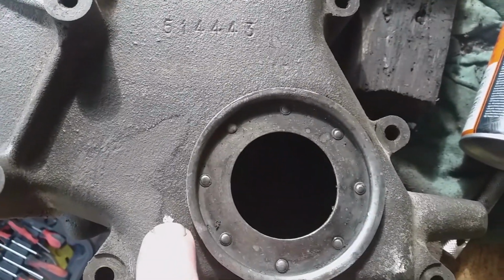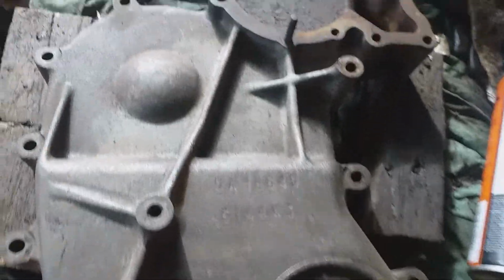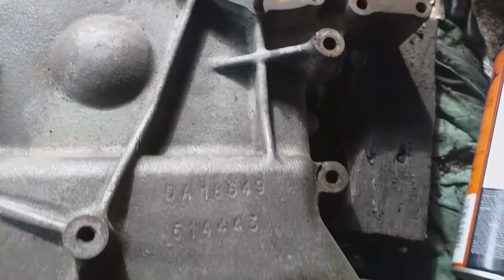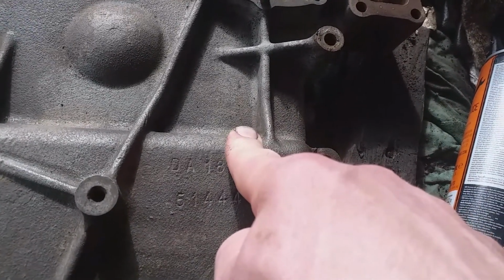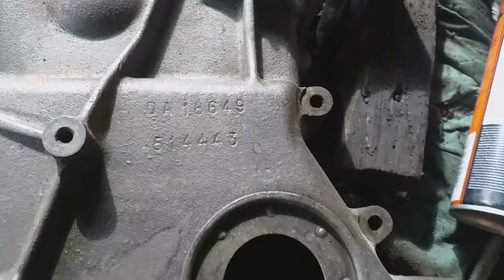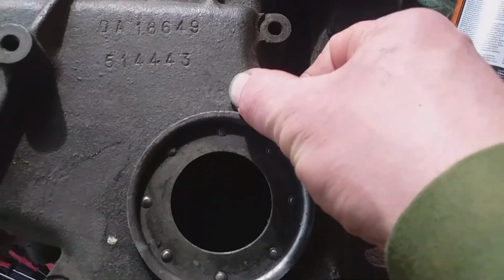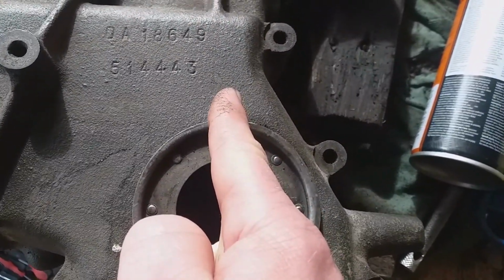So whether that's a factory mark, and it's, you know, this is the original paint under here, and it's worth noting that my engine was the dark grey, which is a kind of Series 1, even though it's like a 1962 prefix A Series 2A. It's got earlier paint on the engine. Anyway, and there's another mark right here. Now that, if you were to line up the woodruff key to that, you'd be at top dead centre.